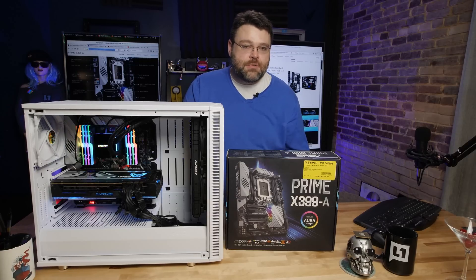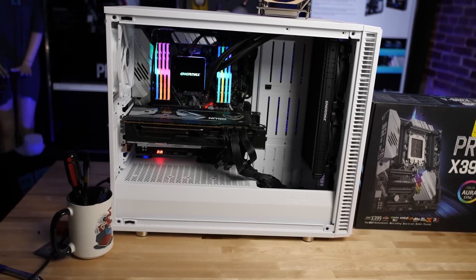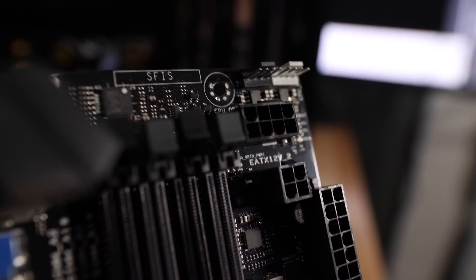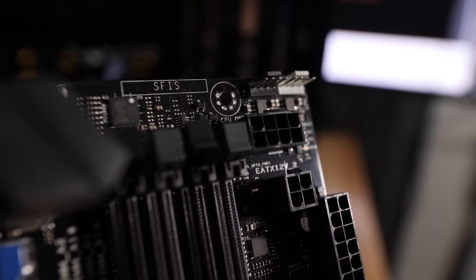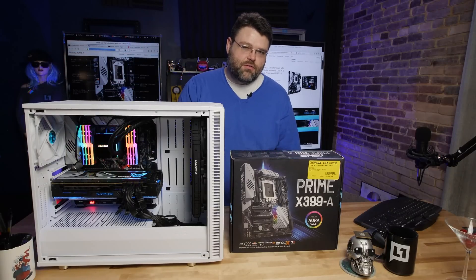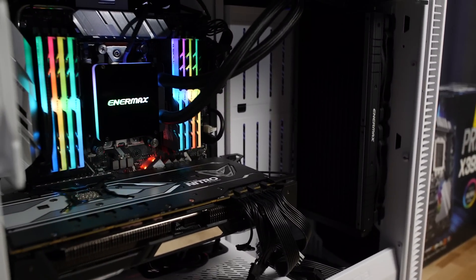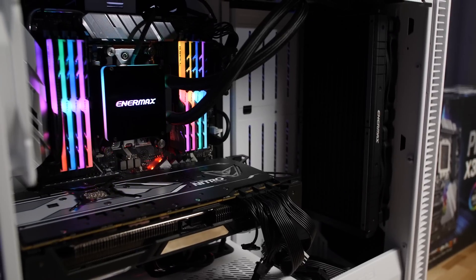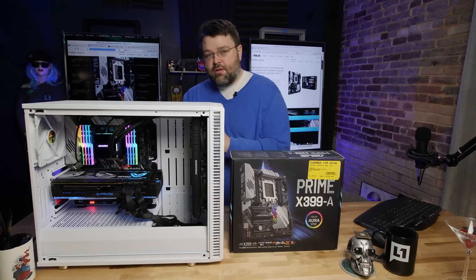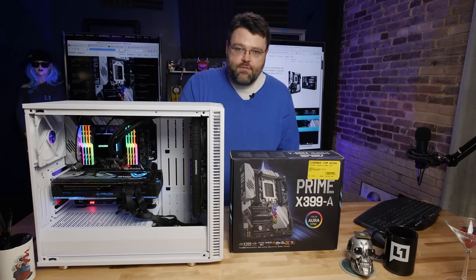I've been running this motherboard for a couple of weeks. It's got some unique features. One of those is Asus five-way optimization — you install its Windows software, run the optimization, and it will find the maximum overclock for you. The board layout is pretty smart: the 12-volt power connectors are on the far side of the motherboard, opposite from where processor power connectors usually are, which makes cable routing a lot easier. As you can see in our build here in the Fractal Define S2, the cables run through the routing grommets and it works totally fine. This motherboard is a little bigger than normal, just a hair, so it sticks over the rubber grommets slightly, but it works fine in the Fractal Define S2.